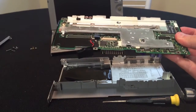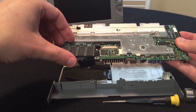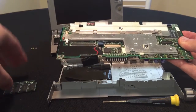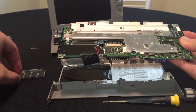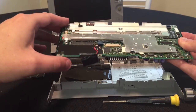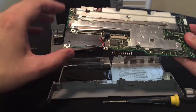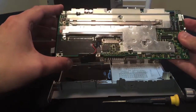One thing with that Protege memory — I'll show you here — is where it sits right here. If you take this off, there's actually a little stub here where usually the CMOS battery would plug into. But by having this, it covers that plug up where you're not able to plug in the CMOS battery. So you actually have to take the stub off and do a little bit of soldering there. As extra precaution, I have definitely put electrical tape around everything just to make sure nothing shorts out, but I had to do a little bit of soldering and I got a new CMOS battery at a local electronics store.